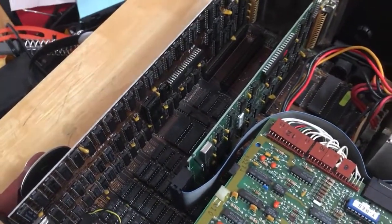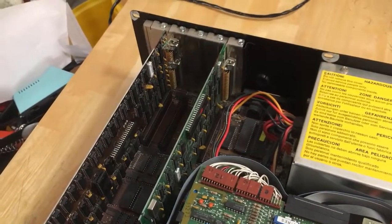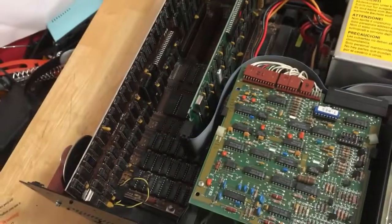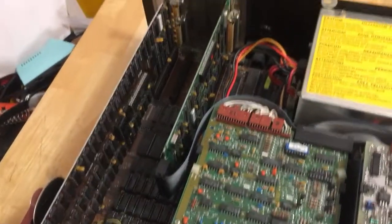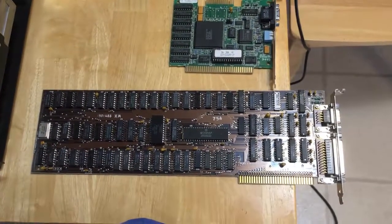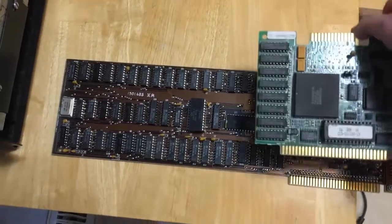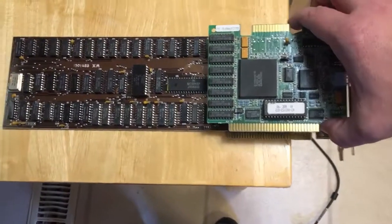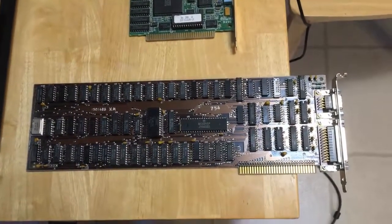I will put it up side by side with the new one I'm going to put in. When I say new, it's a very relative term — I mean it's VGA. This card here is either CGA or MDA — I'll find out. In either case, I don't have a monitor that can actually do either of those things, so we'll be using this flat panel as our monitor. It's VGA, so let's go ahead and get this card out and get the new one put in. I've got the old card out, and there's the little VGA card. Putting the ISA slot pins together, you can see how much bigger the original adapter is.